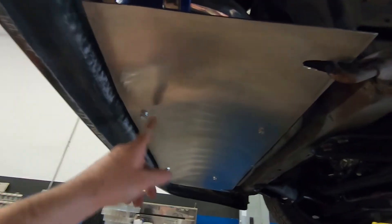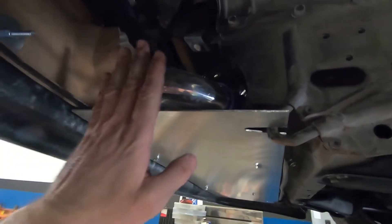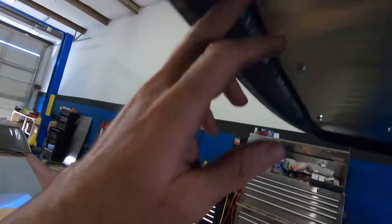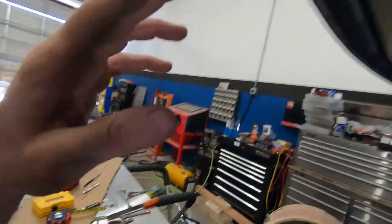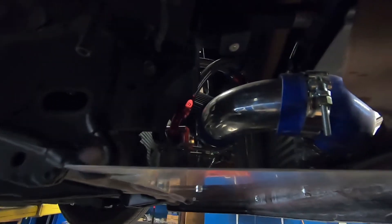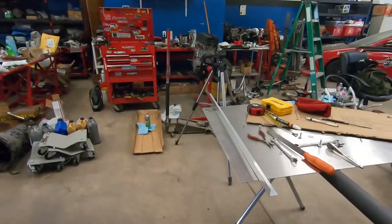Alright guys, I'm very happy with the results. It came out very nice — nice clean four points of contact bolting it up. Now I need to work on the side pieces to just enough close it off to help route the air towards the radiator. I'm going to cut a 90-degree angle piece and mount one on each side, then come up with a template, cut it out and bolt it to the angle piece and bend it over to cover up this big opening right here and help direct the air to where the radiator's at.